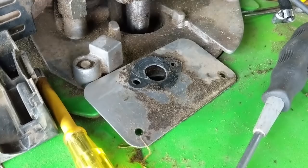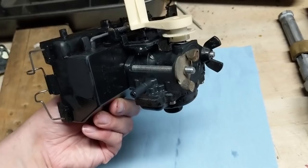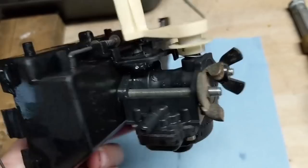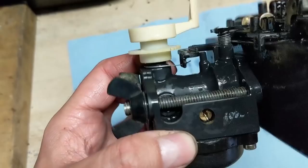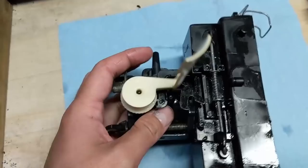What I've done here is taken my hose with a little bit of Spray Nine and did a preemptive clean on it. I've taken a couple of wing nuts and secured the carburetor to the air box. You might be wondering why — well, if we come over here to our throttle butterfly valve, it runs on a spring. This spring is just a wire wrapped around the throttle post and then it goes back to this little lever here.